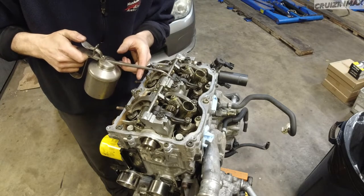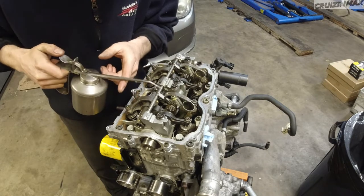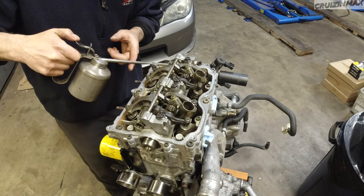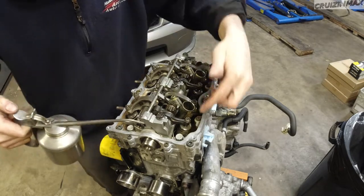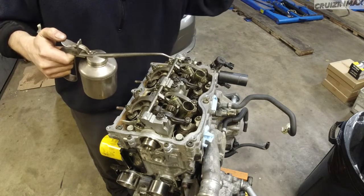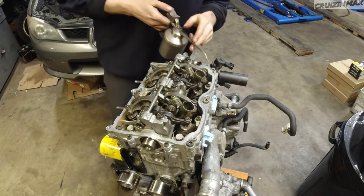Alright, I'm going to call it a day. I'll continue with the valve clearance and adjusting — I'm sure I'll have to adjust every single one on the left head and every single one on the right head. Before I go, I'm going to drop some oil right on top of those rockers and on those pins — whatever is touching and moving. I already dropped oil on the valve stems as well. When we measure those clearances you want oil there so the feeler gauge won't scratch the surface too much. See you next time.